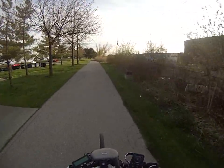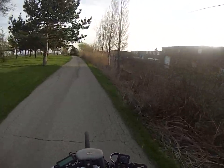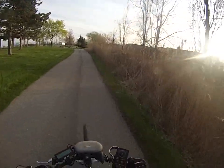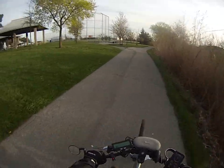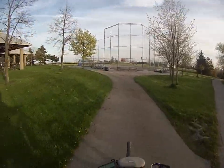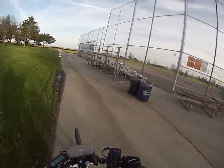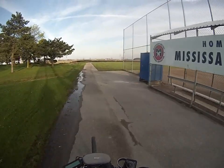It really makes a difference on the slightest of grades, so you'd really have to find a nice flat spot to get it right. I have it set at 140 and this is basically the speed I like to ride on bicycle paths — you've got to have some respect for people and their children. It's rotating around 148 RPM; I'd prefer around 160 RPM. Can't seem to fine-tune onto that spot. So 140 is a little low for the path — maybe I'll make it 150.